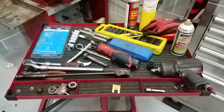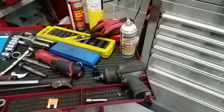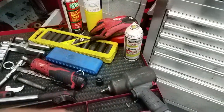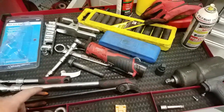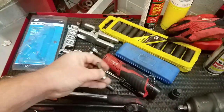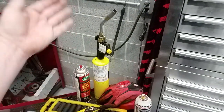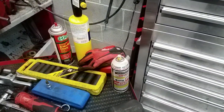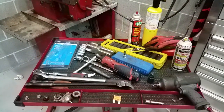Hopefully you won't have that problem, but if you do, don't get frustrated — just get some heat, use the impact, and some PB Blast, which I'd also recommend. Between the heat, the impact, and beating the crap out of it, I got it out. So again, tools you'll need: impact wrench, Milwaukee ratchet, pry bar, ball joint separator, a set of torx bits, impact sockets, and PB Blast. If you can spray everything down the night before, that'll help too.